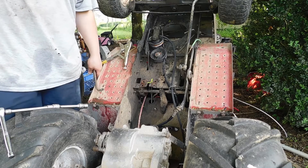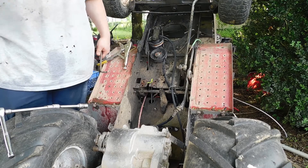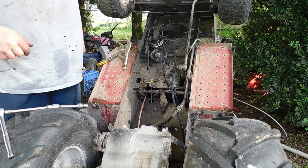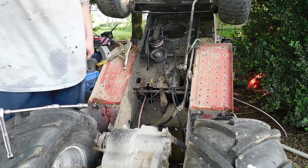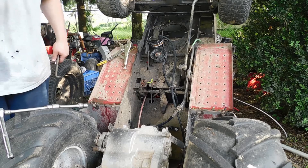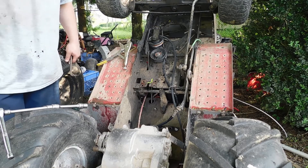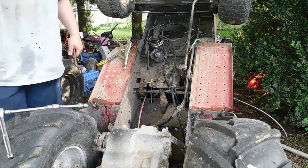Right now I don't have a brake and I'm not hooking one up to the clutch — not acceptable. I really like the clutch being brake-free and I'd rather not have brakes than install one on the clutch. Right now the quickest way I stop is I reduce gear and turn off the key, and I can stop in a couple seconds doing that. I know it's not good for the transmission, but if I need a fast stop I slam it in first and turn off the key.